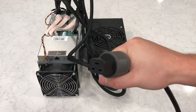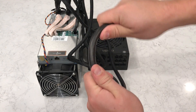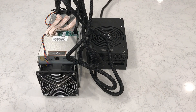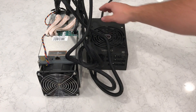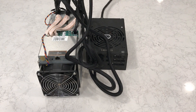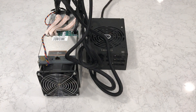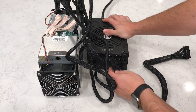Unlike most PC power supplies, this one comes with its own custom power cable. That is a thick power cable. And now for the moment you've all been waiting for. Maybe we forgot something — something like the 24-pin ATX motherboard connector, perhaps. Consumer-grade PC power supplies need some help getting started. Normally, the 24-pin ATX power cable would be connected to a PC motherboard, and the power button on the motherboard would complete the circuit that connects to the specific pins on the cable.